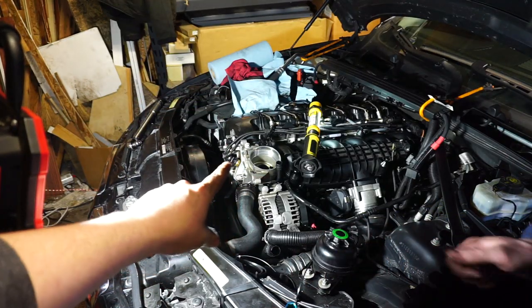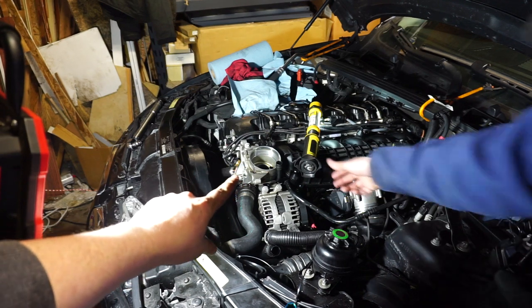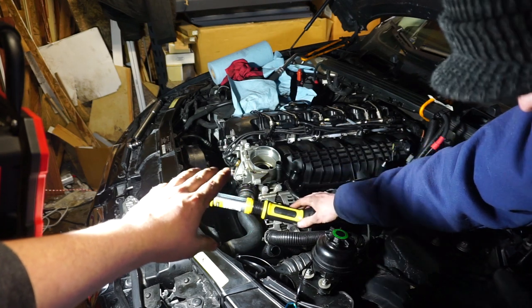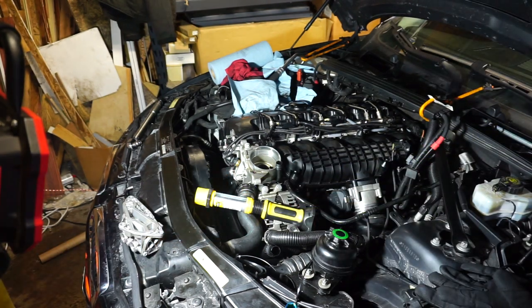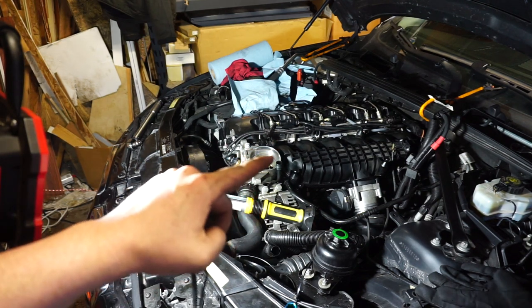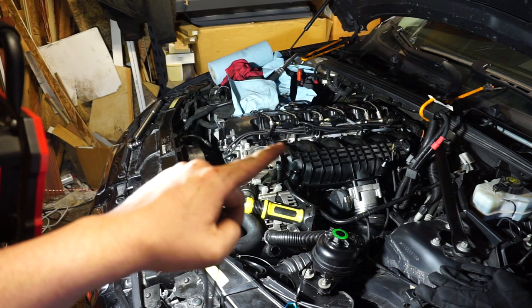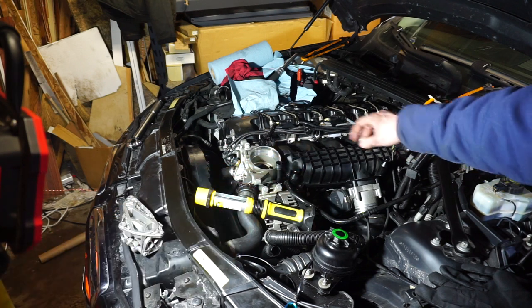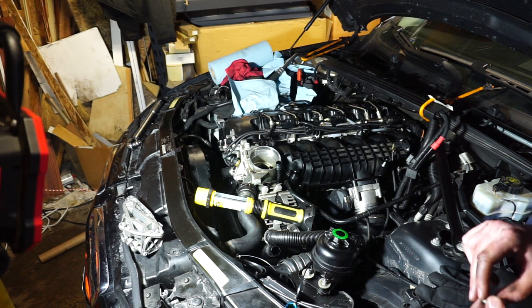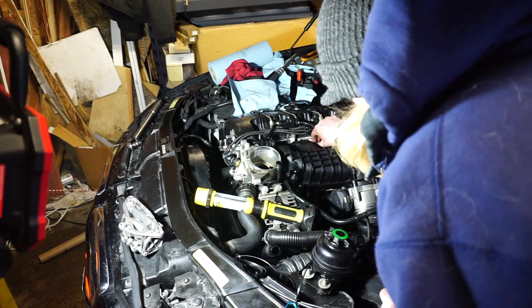Okay guys, then the oil cooler housing, three bolts is 16 newton meters or 11.8 foot-pounds. I'm just going to put this gasket in there, put that on there and do that. Matt, you're going to do the... Yep, I'm working on getting the nuts onto the intake manifold. They're size 11. They're supposed to be torqued to 15 newton meters, from what I understand. We'll have to convert that to foot-pounds, though, because our torque wrench doesn't do newton meters. Yeah, 15 you said, so that's 15. Probably like 10-ish.